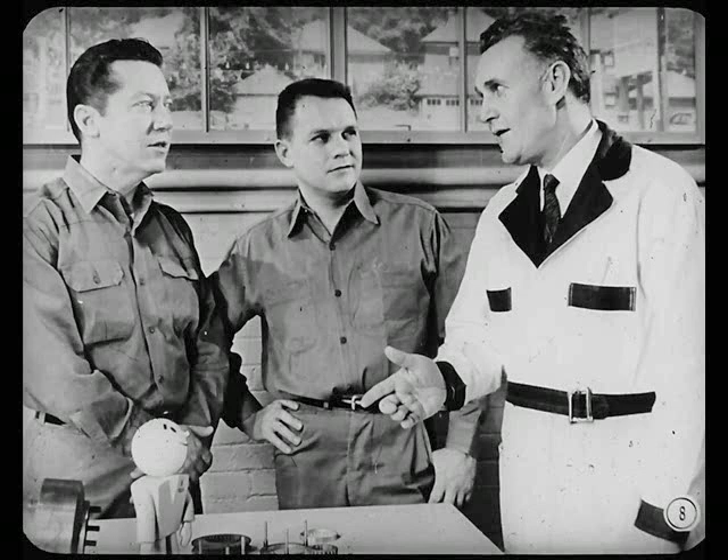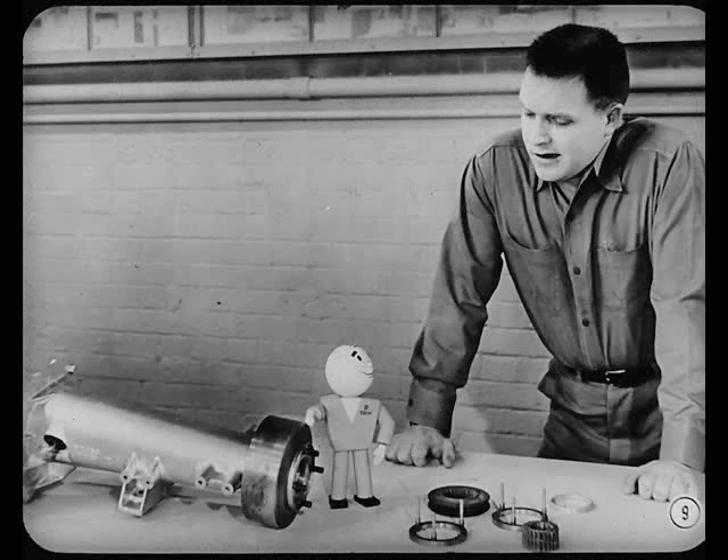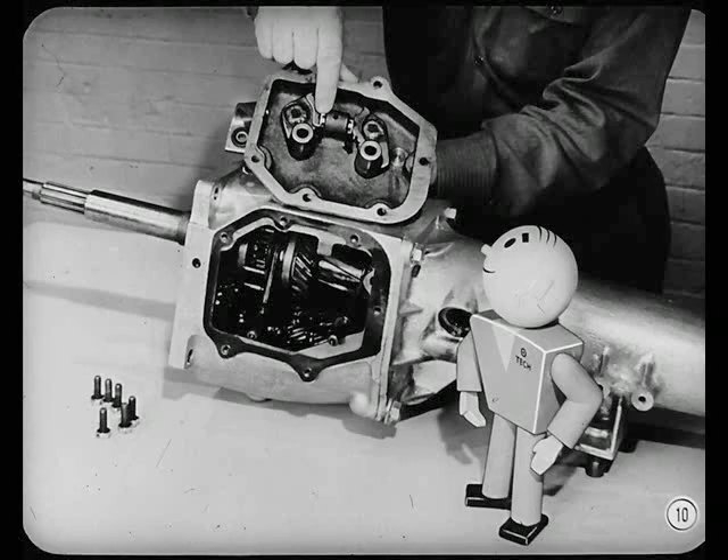When to do it is very important, particularly when you're talking about major repairs. Today we're going to discuss changes in procedures we may run across with the manual and TorqueFlite transmissions. Starting with the K-series transmission, a gearshift housing with interlocks in the housing instead of the case is used, and there's a different linkage setup. The same linkage adjustment procedures apply to the new L-series transmissions — we'll mention this transmission later.